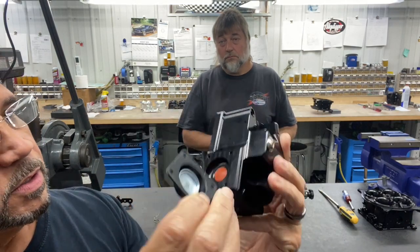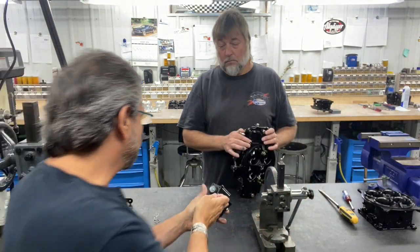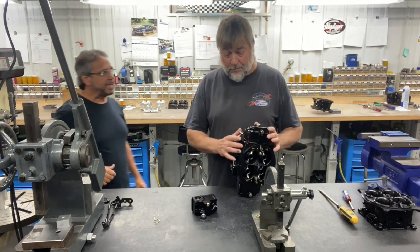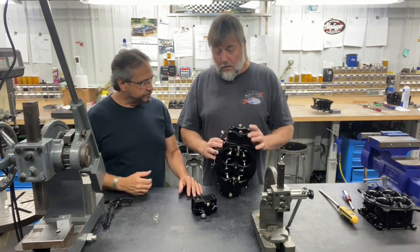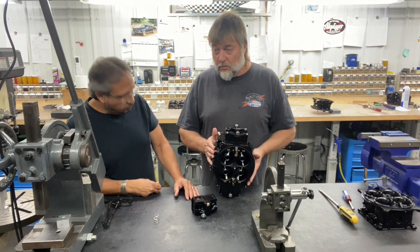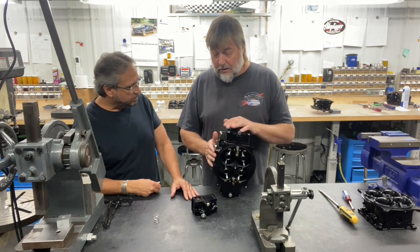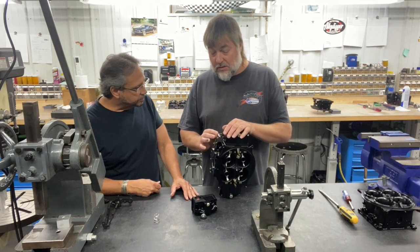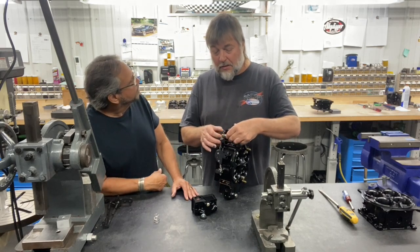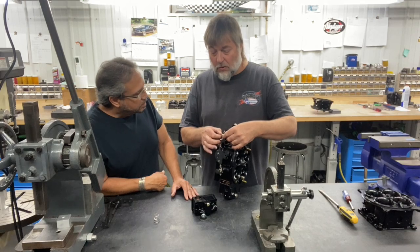You can see that recessed area — that's what he's talking about. This part will cut that diaphragm out and you'll lose some pump shot. We tried to make it so that even if someone adjusts it wrong it doesn't rip the poppet. Now, we believe the correct way to set this is after the idle is set. Once the idle is set properly, we want zero gap here.